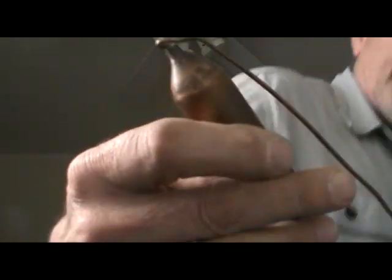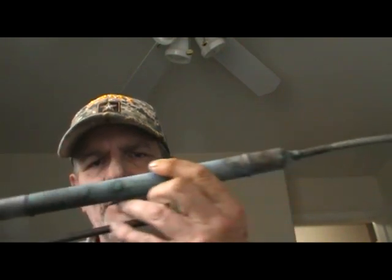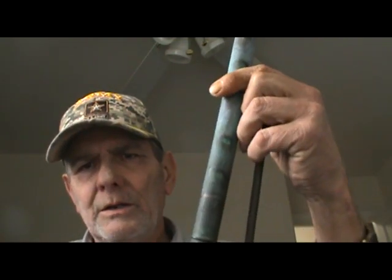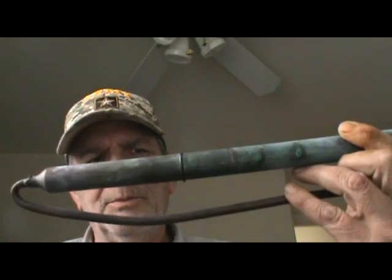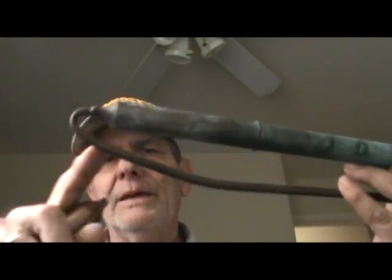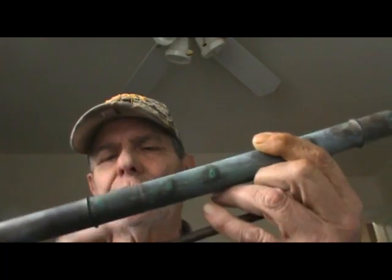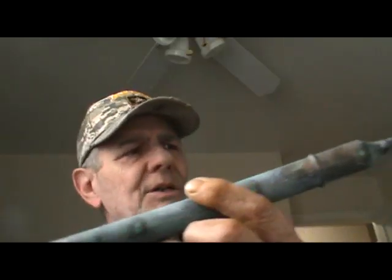There's your dryer. This is another story here. This is Sub-Zero not knowing what they're doing. They call this an accumulator. They're idiots. This is not an accumulator. It's a hollow tube, a 7/8 hollow tube, the suction line. They were afraid liquid was going to go back, so they made the tube bigger so it would turn into gas and go back to the compressor.